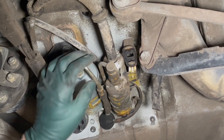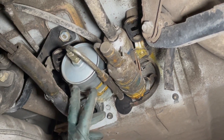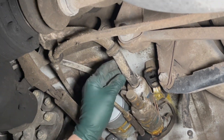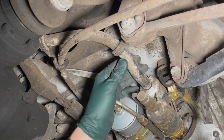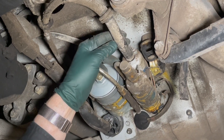You have fuel pumps, and it looks like some of these have been leaking fuel. There's your fuel filter mount. You have rubber mounts up here that rot out, and of course you have hoses here which could also deteriorate. This is a safety thing I harp on all the time with these old cars — get underneath your car and look at the fuel delivery system.